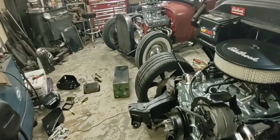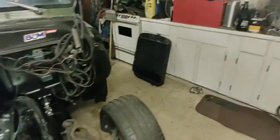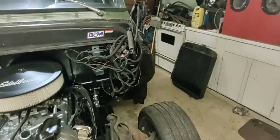I actually did flush that heater core out with the high pressure nozzle on the garden hose. And the radiator, I took it outside and flushed it out. It was about 95 degrees, so it was a good time to get that radiator all flushed out. I took about an hour poking it both back and forth each way from the bottom and the upper, and laying it different directions. Not too much stuff came out, but some stuff did.